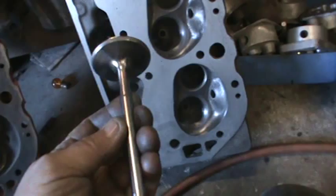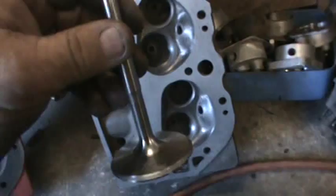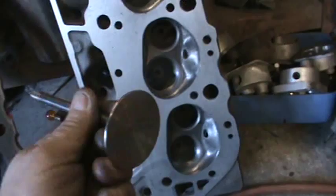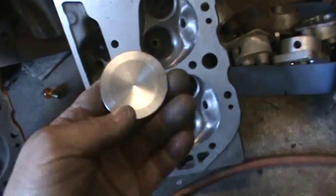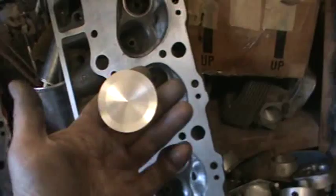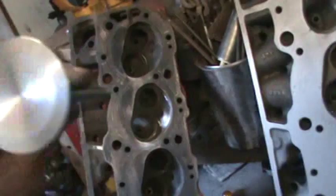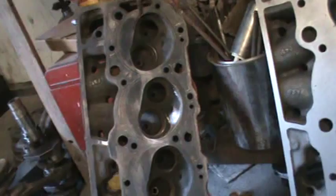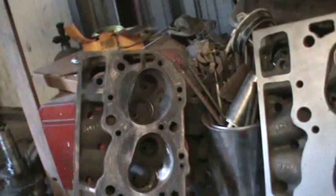This valve is reduced at the stem — it's a Pro Flow, I believe Manley. These are sort of expensive. You can get a really nice valve, spring, and seal kit combination at Competition Products. They have some really good valve combinations for pretty reasonable — you can buy a stainless steel set of valves for under $200. It's really good insurance, because nothing's worse than having one of these valves hit the piston and break the head off. That's what happened to this motor. The valve was so weak it hit the piston and exploded it — it was cast. He didn't have the spring set up for the high-lift cam. When the spring broke, it dropped the valve far enough for the piston to intrude, detonated the piston, snapped the head off the valve, and didn't damage the heads at all.